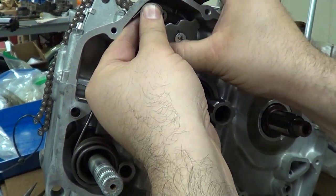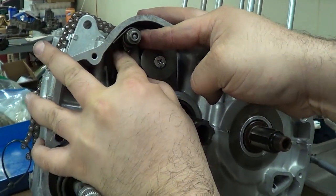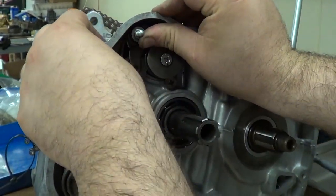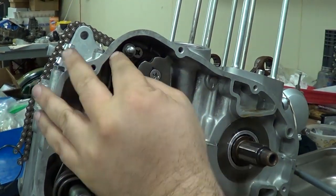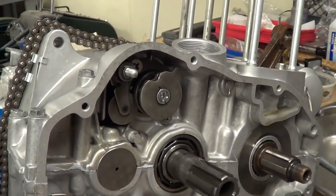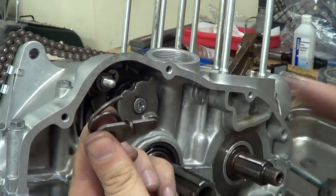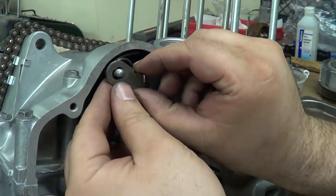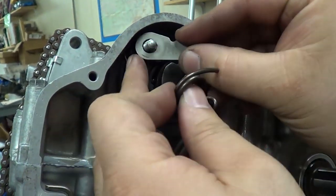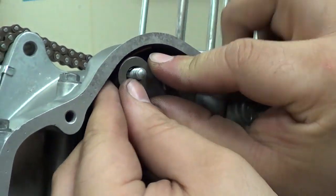Trying to keep it together. Hopefully just put the whole assembly in. I'll have to get the light and take a look to see if we're in position. We got the inner end — we had to kind of tap on it a little bit with the hammer. We have the neutral detent right here. The roller faces inwards. I want to point this out — you can see on this little spacer here it's got a lip, because this guy is going to end up fitting on here like that, but we've got to fight against the spring to make sure everything is in place correctly.